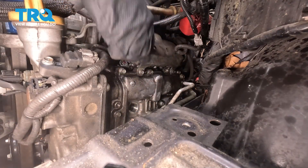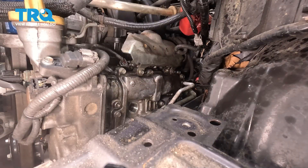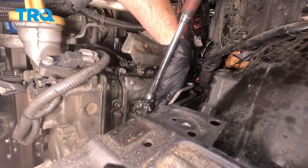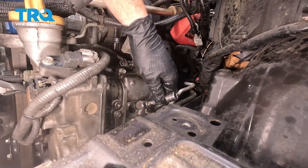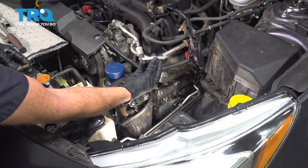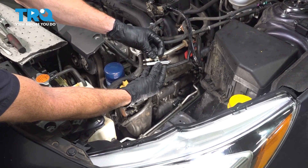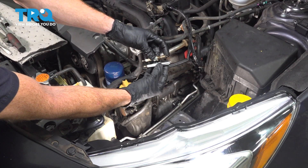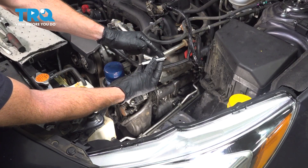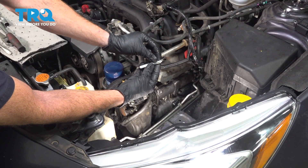Now that we have this area cleaned down, let's continue on with the removal of our spark plug. For this, we want to have a 9/16ths spark plug socket. Now it's time for installation of our brand new spark plug. The first thing we need to do is compare the new spark plugs to the original spark plugs. We're confirming that the threaded area is the same exact length — we can't have a spark plug with threads that are longer than the originals, as that can cause damage. You also want to pay attention to the new spark plug itself, confirming that the ground strap hasn't been peened over or damaged in any way.